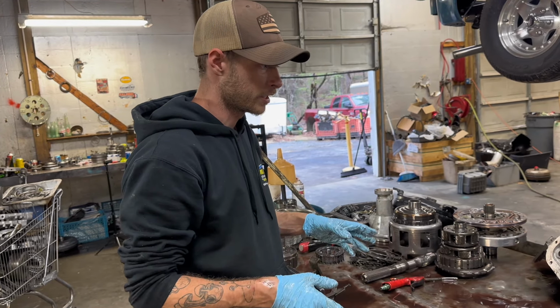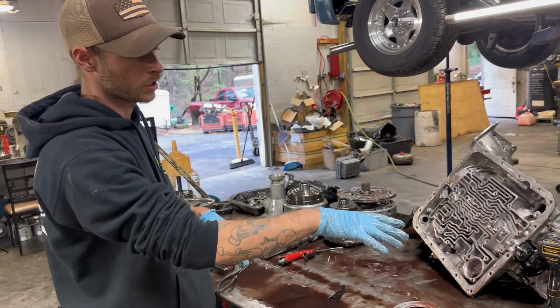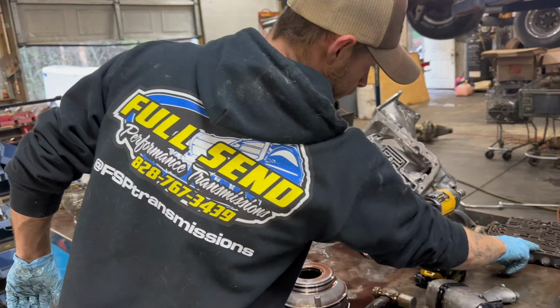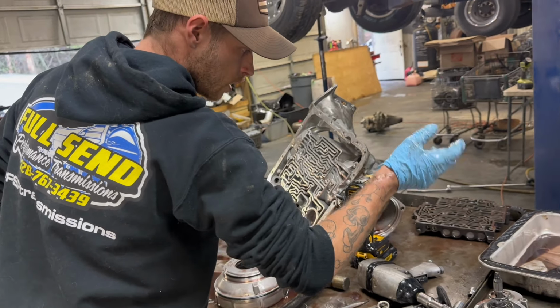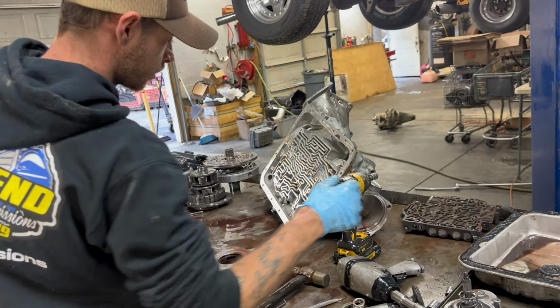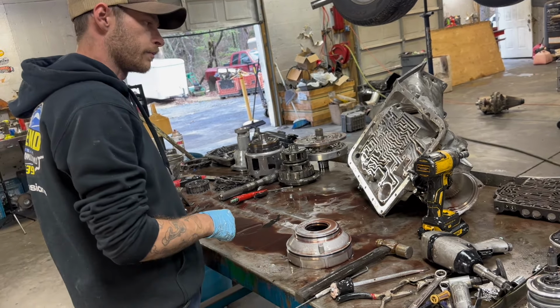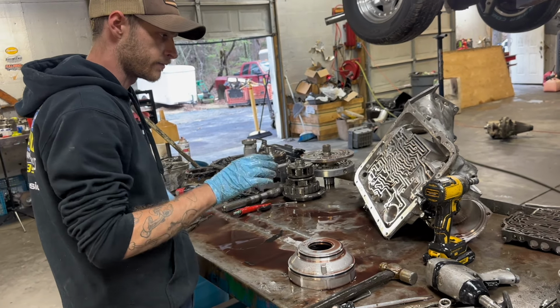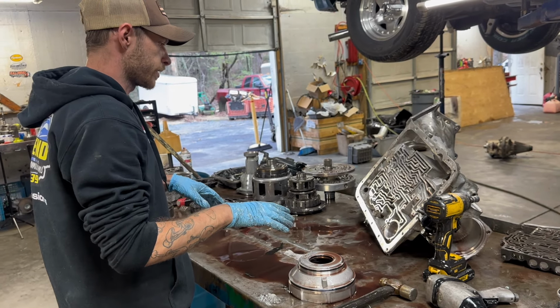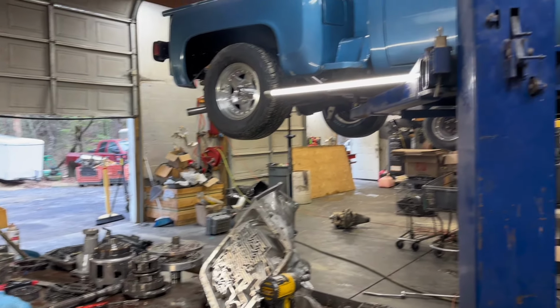Anyway, I'm gonna do a video on building this because we're gonna put a hydraulic lockup switch inside of this. We're gonna put a hydraulic lockup kit in this valve body along with some other parts and a shift kit. Go back with a Corvette servo, a hardened sun shell, wide band, and we're gonna do a couple other goodies to this. But I've got somebody already wanting this transmission, and a turbo 350 is going back in that. So that will be my next video.